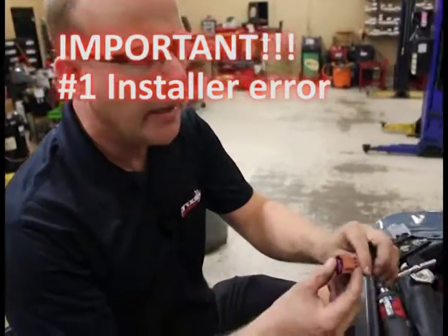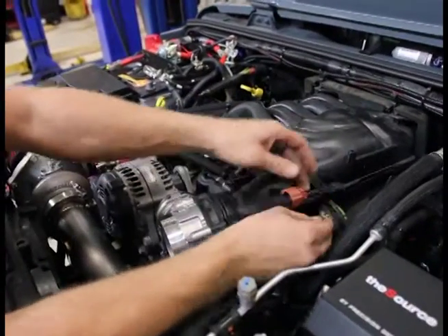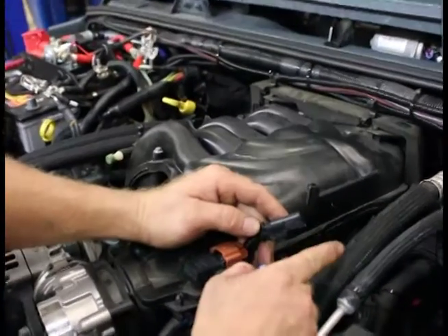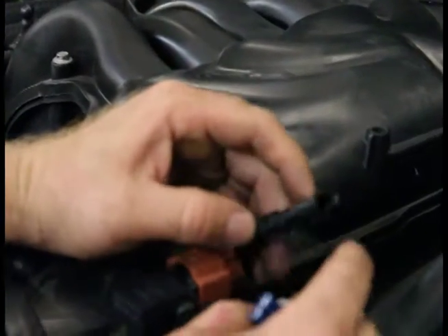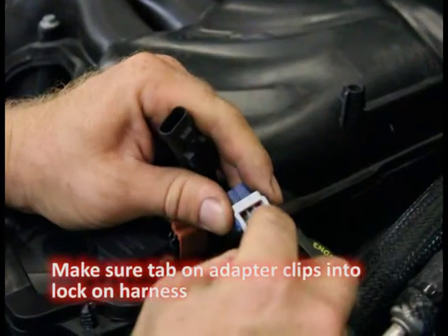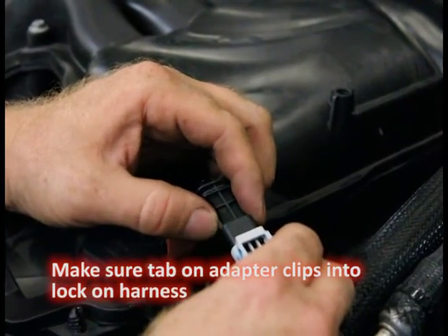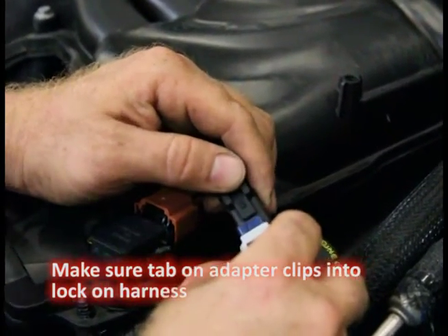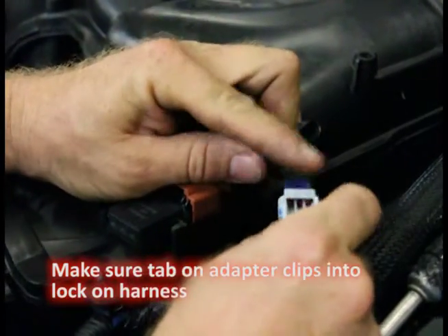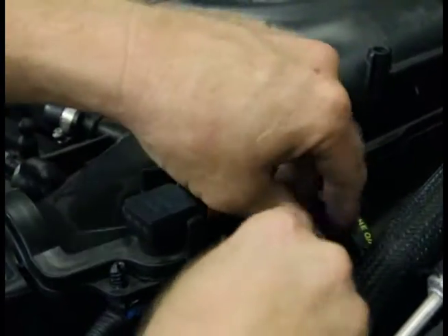On the 3-bar map sensor, it only plugs in one way. Here's the adapter portion — anytime you work on cars, this piece lets you secure it to a harness and lock it down somewhere. It's smooth on one side and has a tab on the other side. The tab is meant to catch the lock on the connector. So it goes just like this, and when you push it you'll hear it click and it'll be firm. We've had people install it backwards and force it on there. The tab side is for the lock — push it straight together, it'll be firm and click right on. Very simple.